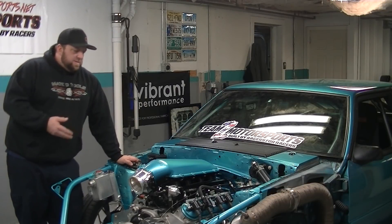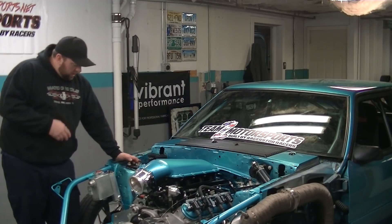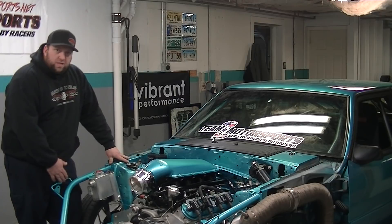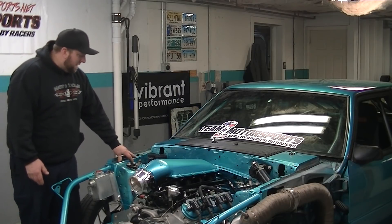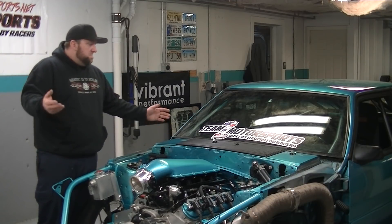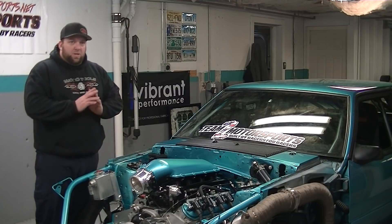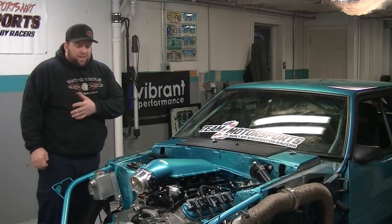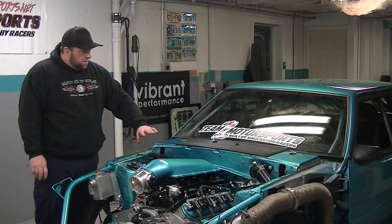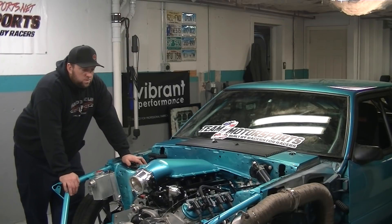I let it dry and then got this heavy car pushed back over so we could start final assembly. It came out pretty good but it looks like crap on the strut towers because it's not an exact match — this was just single stage mixed up in an aerosol by a paint shop, wasn't perfectly matched to the body. Whoever painted this car added a lot of gold into it. But next winter this is all getting taken out anyway, and I'm redoing the whole bay — shaving holes in the strut tower and firewall and repainting everything.